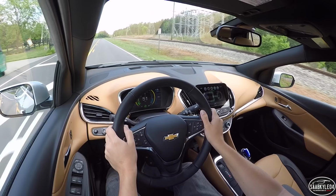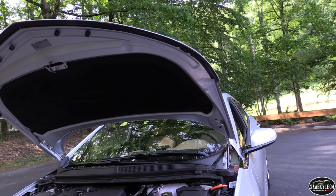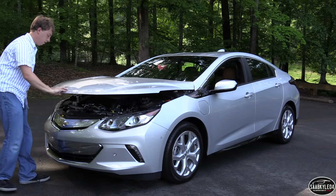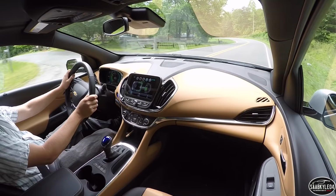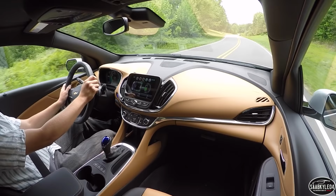As we've stated, the Volt is an extended range electric vehicle, which means the wheels are driven by electric power. The onboard gas engine serves as a generator primarily, supplying extra juice when the battery runs low or if you want to maintain your current charge for later use. The new Atkinson Cycle 1.5-liter range extender replaces the previously used 1.4-liter unit, bringing more power and better fuel economy. Benefiting from all-aluminum construction, dual overhead cams, 4 valves per cylinder, dual variable valve timing, and direct fuel injection, it's a more modern power plant that also drops some weight.